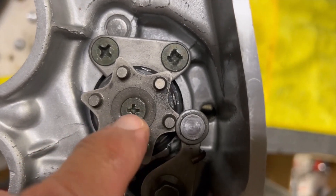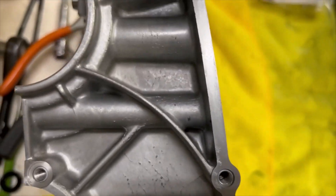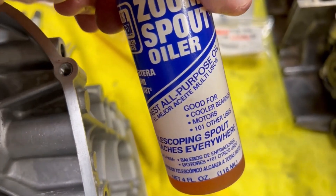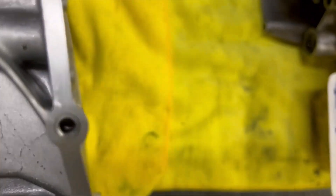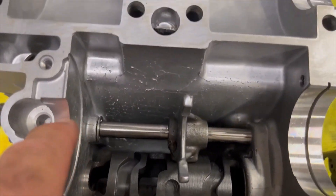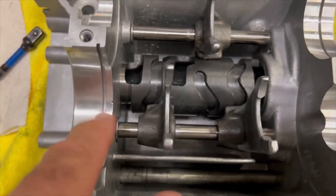You don't have to take this apart — just take the whole drum out and slide it in. Make sure you put some machine oil, all-purpose machine oil, on your parts, on the bearing surfaces. The bearing surfaces are here when you get your crank in.